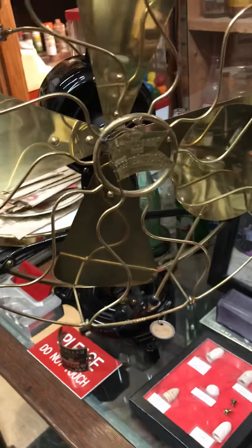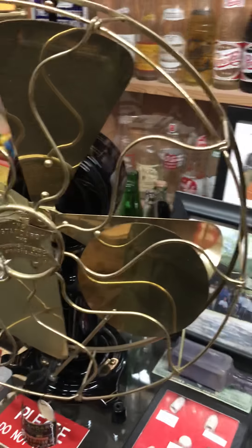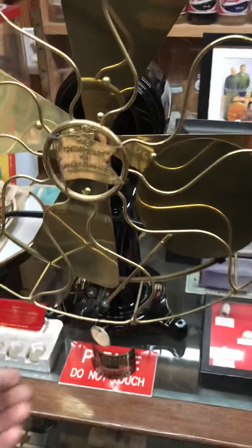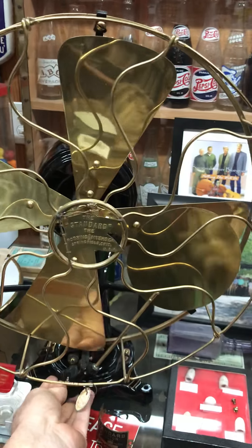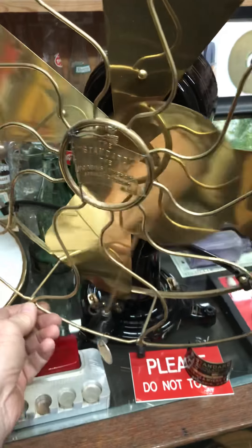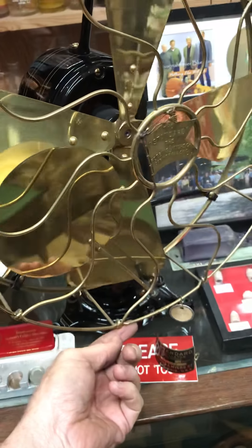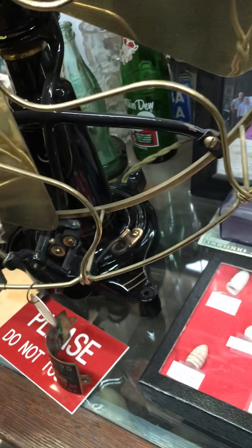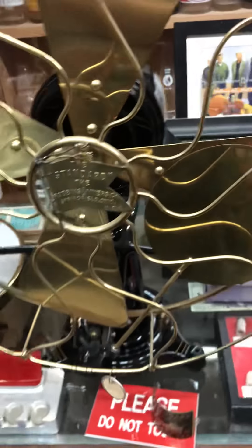There are also a lot of people that may have never seen a Robbins and Myers lollipop before, or at least the inner workings of it. You've got the counterweight down here and this disc that is pushed by the wind coming off the blade to this side. When it gets far enough around it hits a reverser that flips it the other way, and the wind pushes the fan head over to the other side where it hits another stop and flips the counterweight back — that's how the fan oscillates.